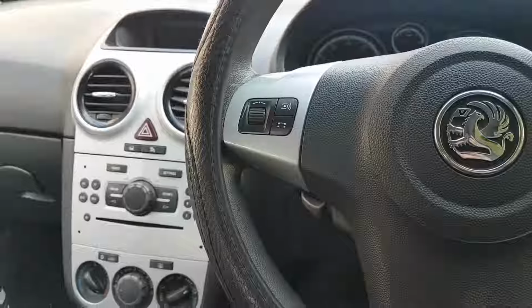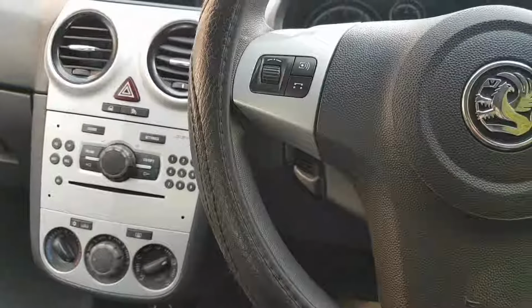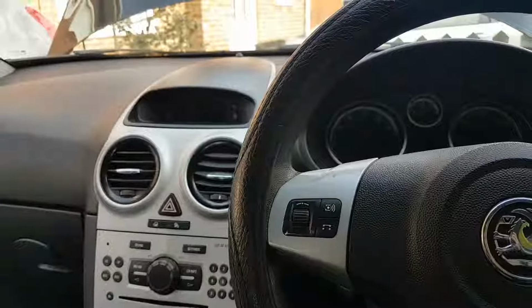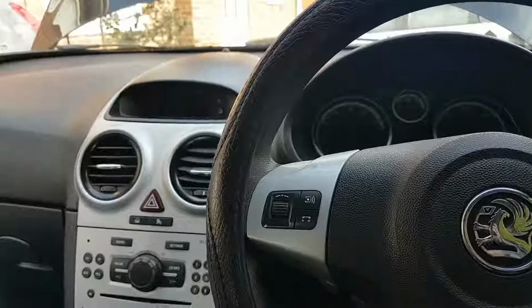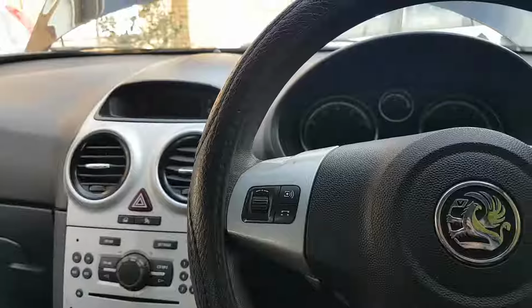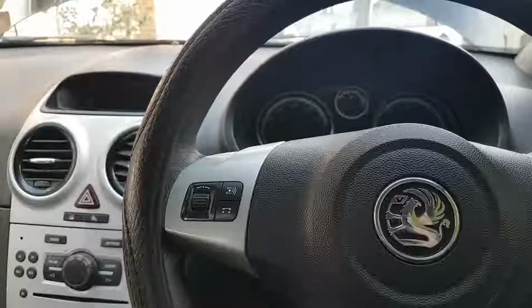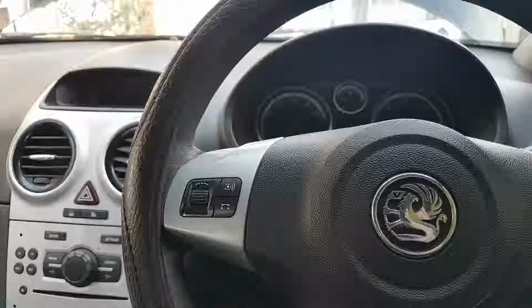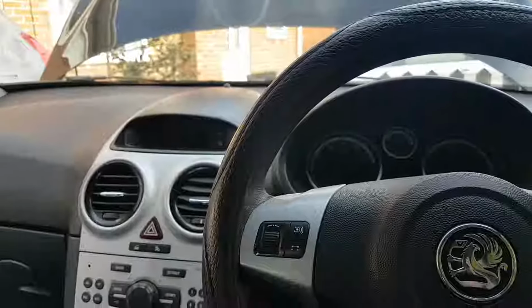So, what I'm gonna do, guys, the first thing I'm gonna do is I'm going to possibly put this ECU back in place, because this unit needs to be grounded, is grounded at the body. So we're gonna ground the ECU and just make sure everything there is still connected, and we're gonna scan the car and go from there. Really put the battery on charge, because there is no battery at all, and see what we got there. But if I would have seen under the hood before, I don't know if I would take this job, but too late now.